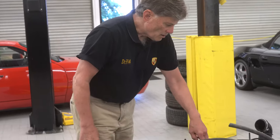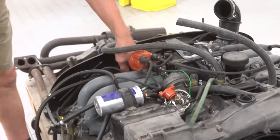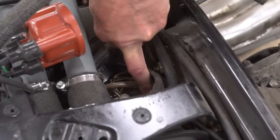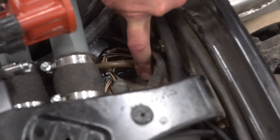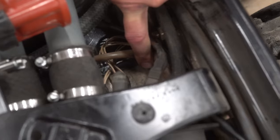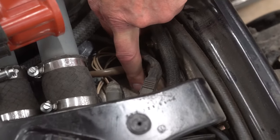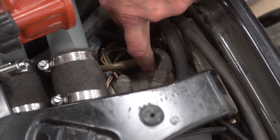Now I want to talk about the engine in general, starting with the ID number. The 1.7 and 1.8 models have the engine ID number at an angle at the right back of the block. As you can see right here, this one starts 'EA'. EA is a 73 1.7 engine specifically. If this had EB or EC, it would be a 1.8, and if it had WO, it would be an earlier 1.7.